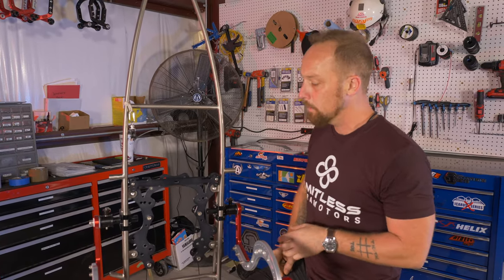You'll have more leverage. I'd also like to mention the harness adjustment bar. This mostly comes into play for launching. What I've been doing, especially for student machines, is I will bring it up to this third hole. Makes it a little bit easier to push back against the motor when you're launching. On my personal machine, I even have my harness adjustment bar offset one hole. It makes it feel more even when I'm on full throttle with my factory R. You have less tendency to want to go like this on your roll axis, and it makes it feel a bit more even when you offset this bar as well.